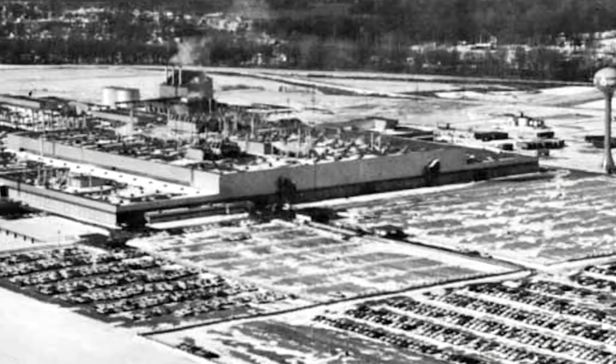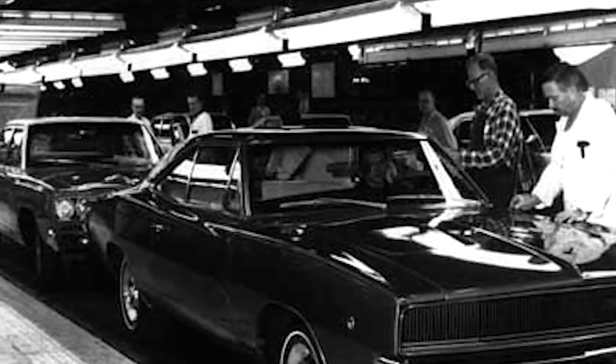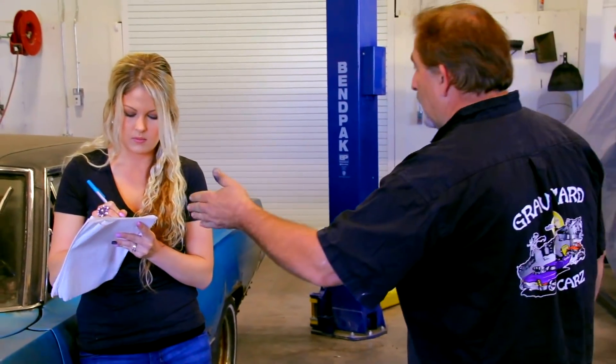What's the seventh character? Looks like a G — St. Louis. So the car was built in St. Louis, Missouri. Write all this down. The car was built in St. Louis, Missouri. It's got a 375 horsepower 440 Super Commando engine. It's a true GTX according to the dash VIN. Our job is to make sure that the rest of the car matches that.